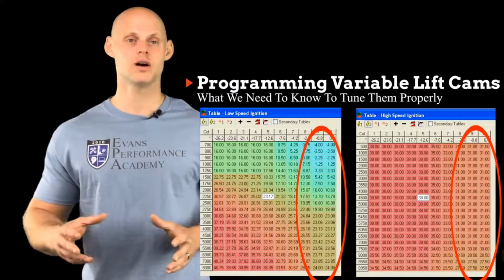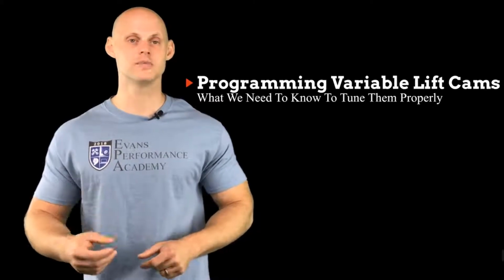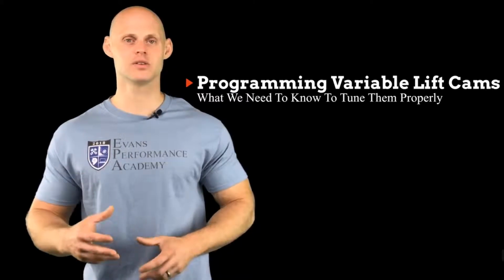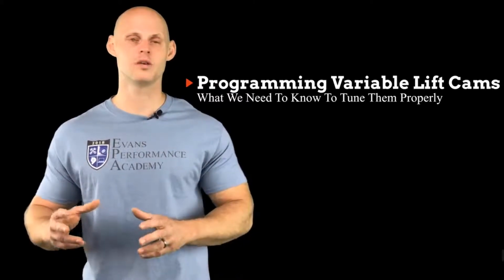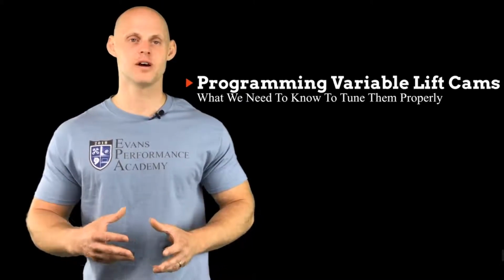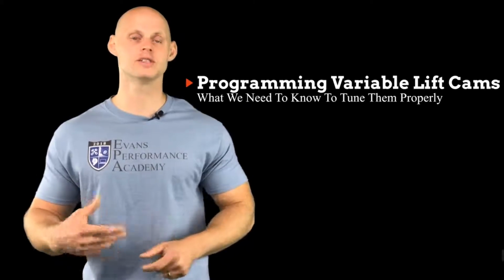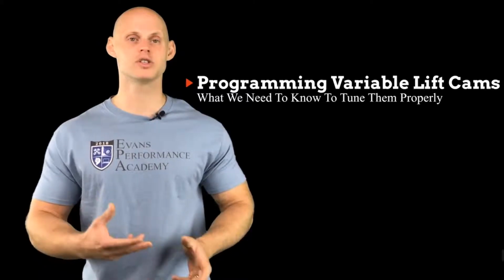Now that we know how Honda went ahead and controlled the variable valve lift system, or the VTEC system, let's look at how we're going to do it on a standalone. Now, most standalones are not going to have two sets of tables. We're going to have one main fuel table and one main ignition table. So we're going to have to go ahead and characterize this variable valve lift when it switches over, and have the fuel table built so that it has enough fuel there, and then we're going to be able to make that switch over point and not have any stumbling where it's rich or lean.